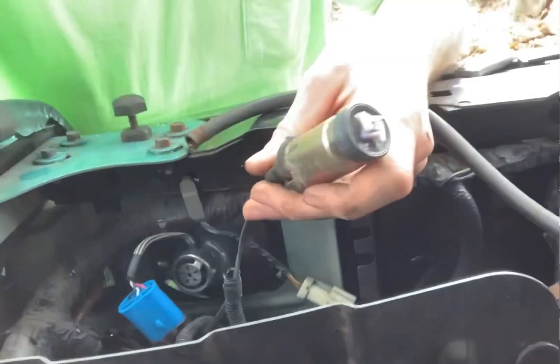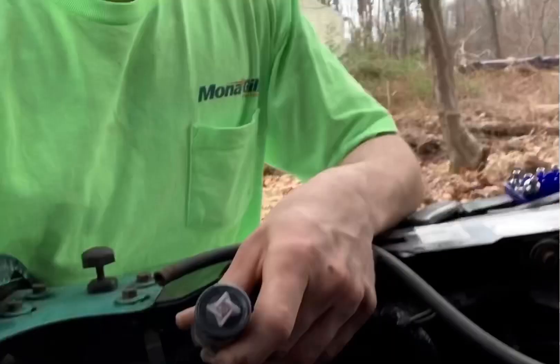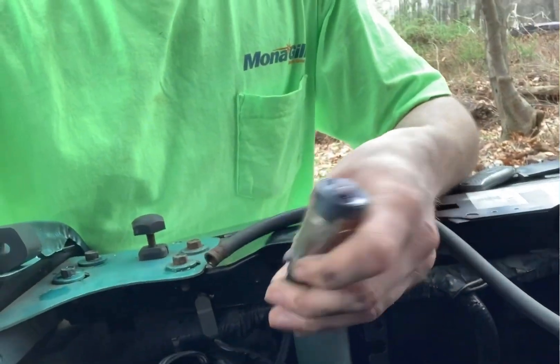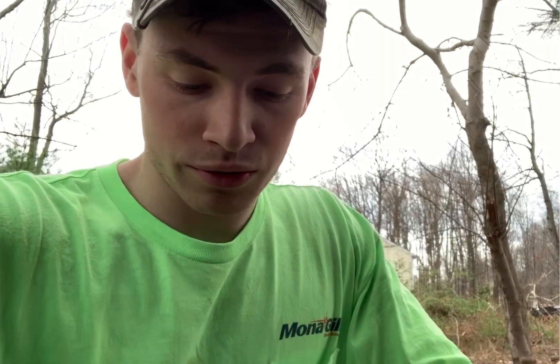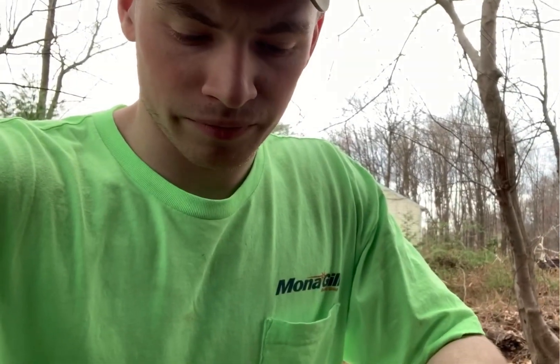Alright, so I just hooked up the washer fluid pump to see if that worked, because we haven't had any washer fluid in there for a while. I tested it before I hooked it back up to the reservoir and it's not even moving, so that must be burnt up. I'm going to have to run out at some point and get a new one to put in the new reservoir before I install that. I'll hook all the hoses up and get it bolted up for now, but I'm just going to leave this out until I get a new one to replace it.